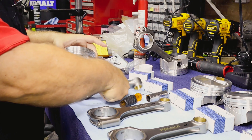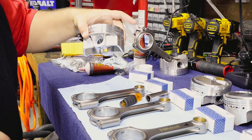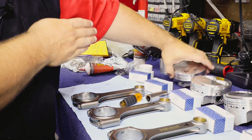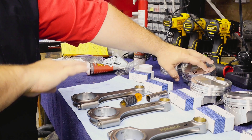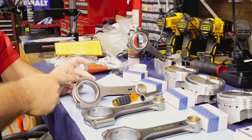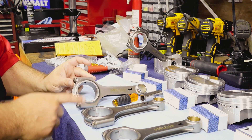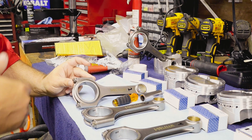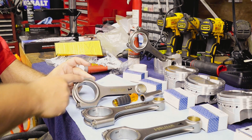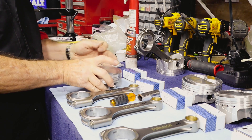To keep the oil from going up here, we'll go ahead and install our oil rings and our various compression rings. We're going to get that process started, and when all's said and done we'll work them in order: two, three, four, and so on. Additionally, if you look at the side of the rod itself, we've gone ahead and etched our numbers in here — so we know that this one lines up with number two, three, four, and so on. If we ever need to change something out, replace the crank, replace something, take these out, et cetera, we know exactly where those will go. You can do that on the side or some people have even etched in the center itself. We're going to go ahead and show you the process for number two now.